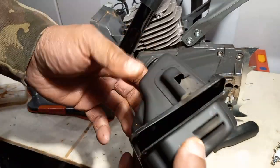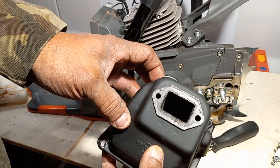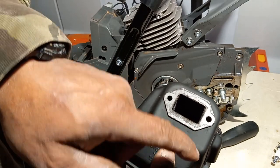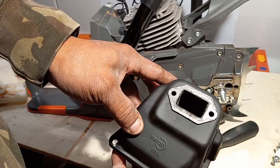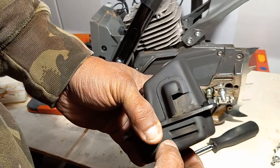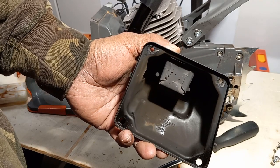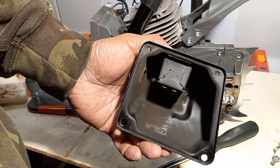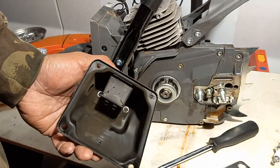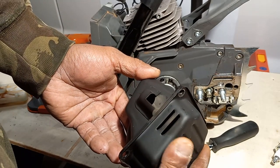Your muffler here comes with a gasket on it, which is pretty nice. If the gasket didn't seal well you would see hot spots where the exhaust came out, but clearly it looks like it's sealing very well. The muffler looks good, and you can tell it was still a little lean because of the chalkiness. The interior of it, even though it's been run at 25 to 1, there's very little residual oil — probably because I was running it lean. The interior looks pretty good. I might actually add an extra port to it because you've only got these two little small ports right here.